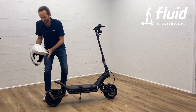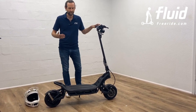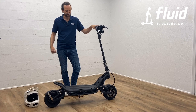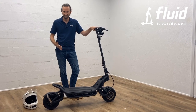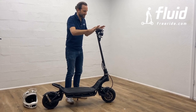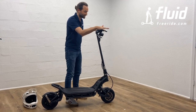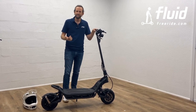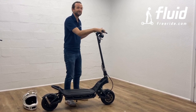Now, one additional thing I wanted to point out to you is what riders call speed wobble. On regular operating speeds of 25 to 40 miles an hour, which I think is the sweet spot of riding this thing, you may never really notice. But speed wobble is essentially when your front wheel starts wobbling while riding, just because of the way the dynamics work on the scooter. Now, I'm no engineer, but you can actually feel it. Even if you go at like 15 miles an hour and you slightly move your fingers like this, you can feel how this can potentially start rolling.